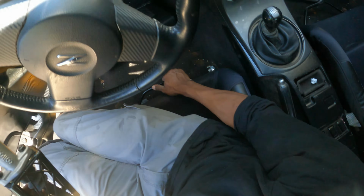All right, first thing we have to do is take off the airbags. So we need these, I believe this is Torx, but we need the tamper-proof one, the one with the hole in it. Let's see what size this is. One more bigger. I'm getting really good at this. So it looks like we're gonna need a T40. Oh, no, I was right, T30. All right, cool, first try. So we're gonna need a T30 bit.